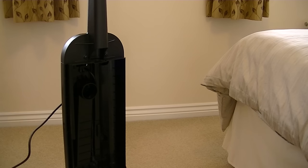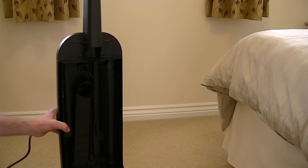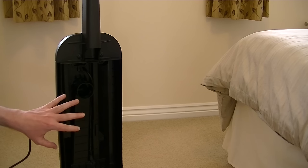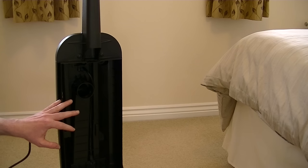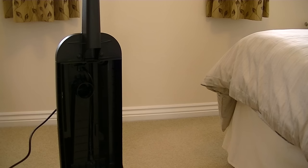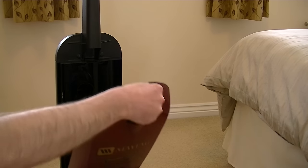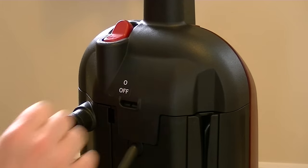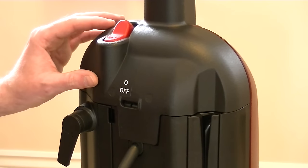Now the next stage in the instructions is to put the filter bag in place. I've searched high and low and no filter bag was supplied with this vacuum cleaner, which is a shame because in the UK they are very expensive and hard to find. I do believe that I can fit certain Hoover bags to this — the Hoover Turbo Power bags, or the Ranger Senior that used the top fill bag. So I can't do a quick demo at the moment as I haven't got any bags to hand. Once the filter bag is in place, we attach the bag door and close it. At this stage I can remove this little plastic switch lock by pulling it out, and now I should be able to operate this rather large red on-off switch.